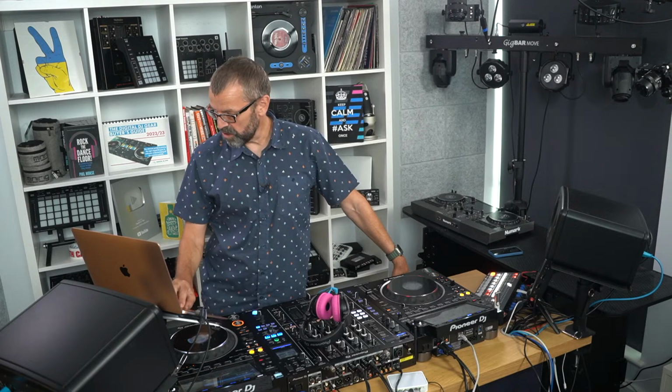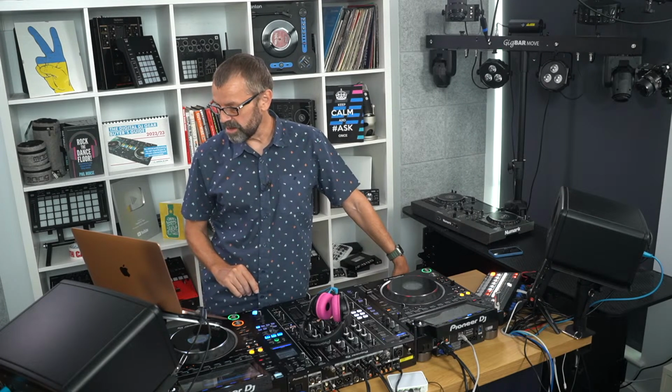So this is from, let's grab some questions here. BeatLab says, I have the 3000s. Do I have to update my players? Yes, you do have to update your players. Updating your players is very simple. You go to the Pioneer DJ website, then you go to the CDJ-3000 support page. When you're there, you download the version 3 of the firmware. You put that onto a USB drive and unzip it if you have to. It's just one single file, put it onto a USB drive.